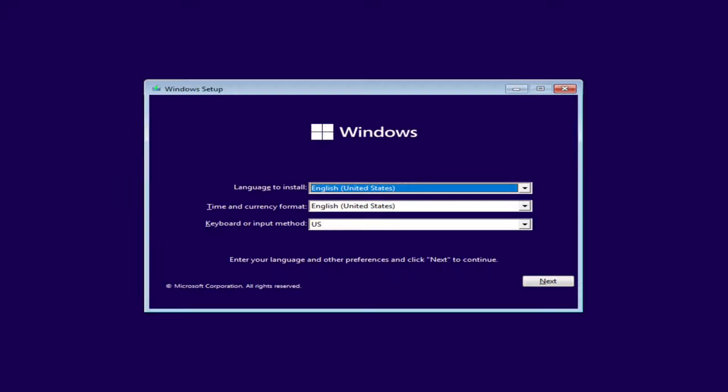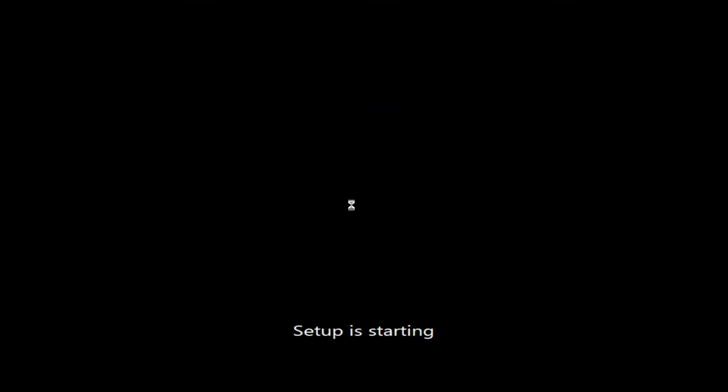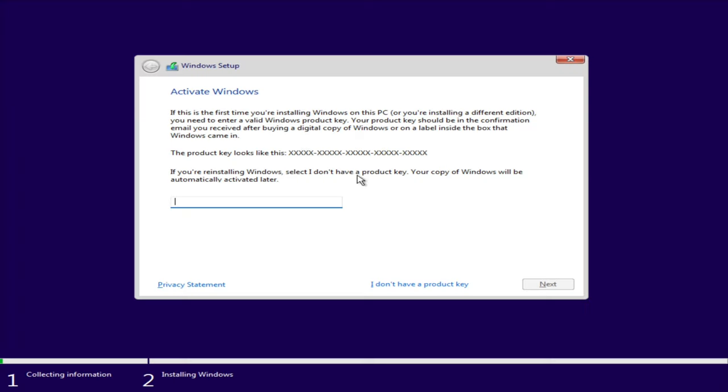Martin says booting from a hardware RAID, playing with fire, for sure. I don't recommend booting from a RAID drive because it can make any sort of repair of the operating system very difficult. But let's see what happens. I'm kind of curious if Windows will see the RAID array. I don't think it will without a driver. So let me just verify that now.